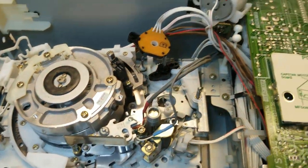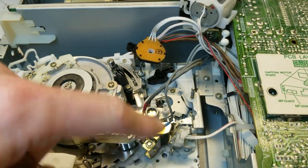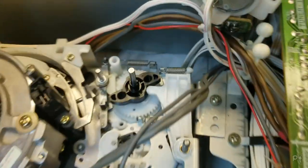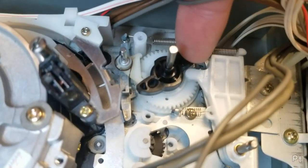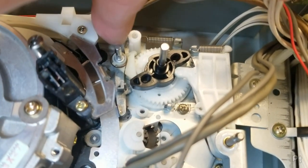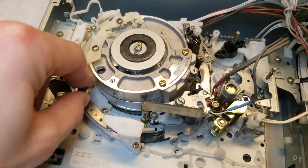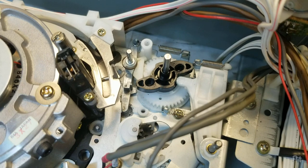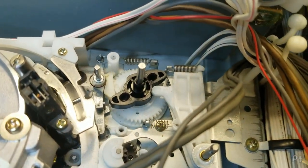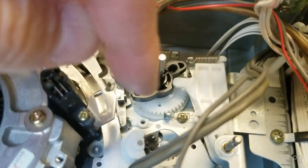I don't know why. The wires were dressed in such a way that I don't think this has ever been opened. It seems like people have done other stuff on this machine, but I don't think this part has ever been touched. When I look at this gear, it's getting stopped by that metal peg there, and that metal peg will not move out. See, it's spring loaded — it pushes against this gear that goes all the way around, the loading bead. There's a bit of a divot, and I'm looking for enough of a divot where this gear can spin, but I can't seem to find it. So I don't know how this rotary encoder switch ever changes, because this little pot metal piece is always preventing it from moving.